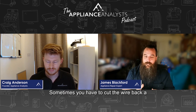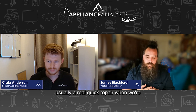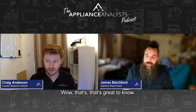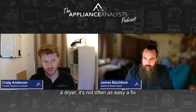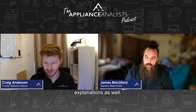Sometimes you have to cut the wire back a little bit if it's real crispy, but that's usually a real quick repair, and we're talking 20-cent electrical caps to connect the wires together. Yeah, wow, that's great to know. Especially as, when we've spoken about a burning smell with a washer or a dryer, it's not often as easy a fix as that.